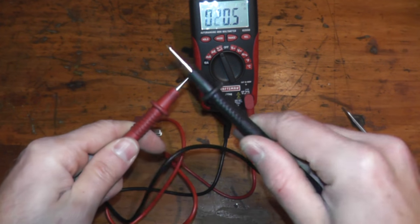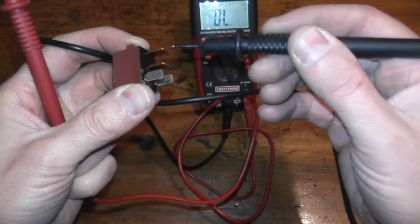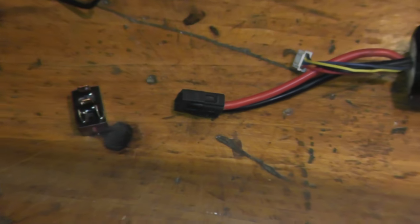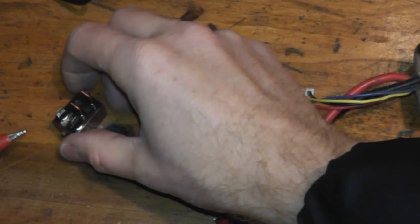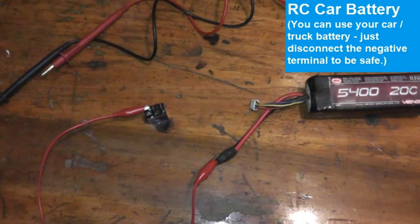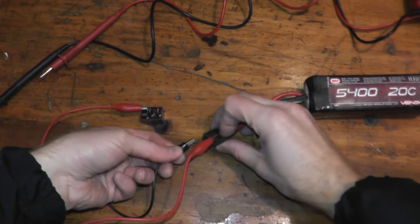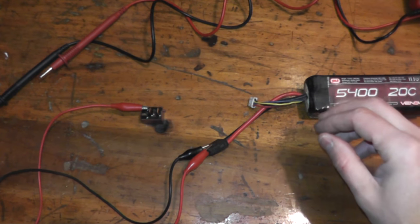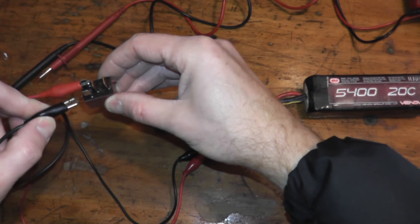What I'll be using are these alligator-type clips — makes the job very easy. Just be careful when you hook this up. What I'm using here is an RC car battery pack that pushes out around 11 volts. You can use your car or truck battery, but just be super careful — disconnect the negative terminal going to the battery just in case you create a short. We'll apply power to the bottom two prongs, and we should hear a click. You hear that? So we know this relay is working right off the bat.